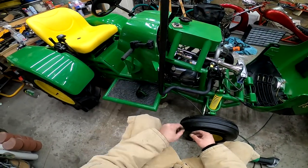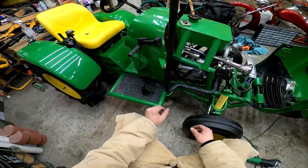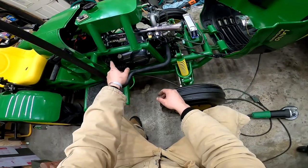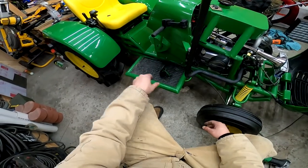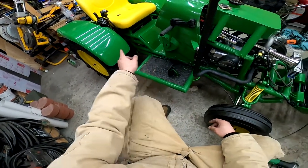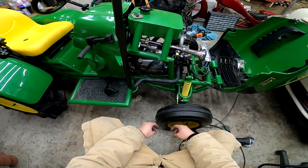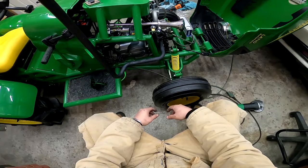Additionally, my speedometer should now work because I got it adjusted again, to where I think is the correct spot. I got the magnet lined up on the back, so that should work. I also adjusted my chain to take the slack out. Got a new sprocket up here, so this should be spinning it faster. Got a bigger sprocket for down there, so that should be spinning faster. And I replaced the one link that was missing a roller. So hopefully, all said and done, this thing's ready to rock again. But I don't know. We'll see.